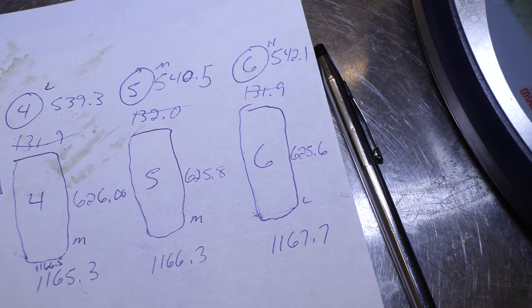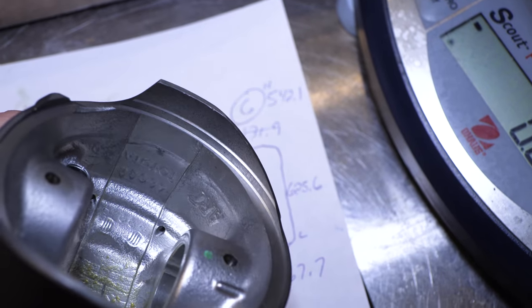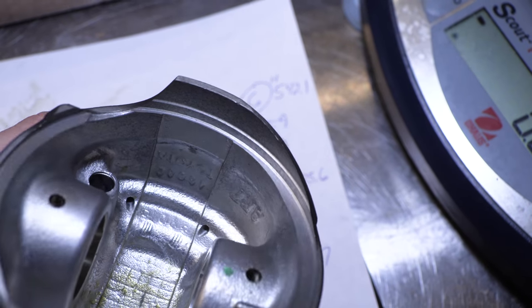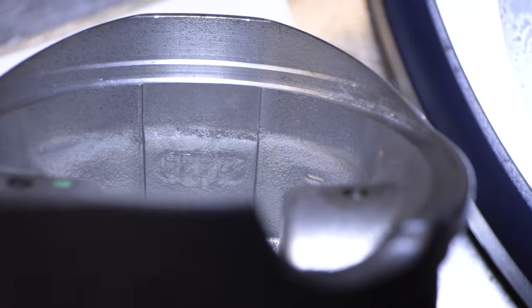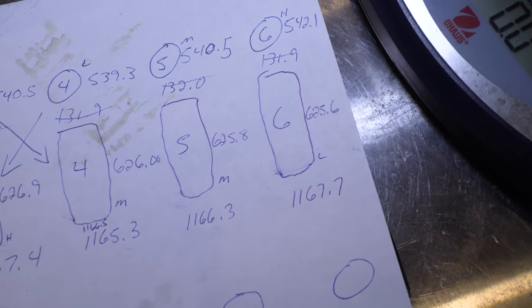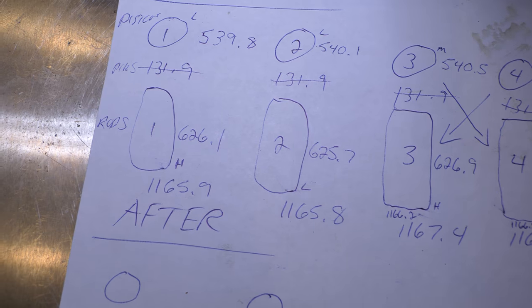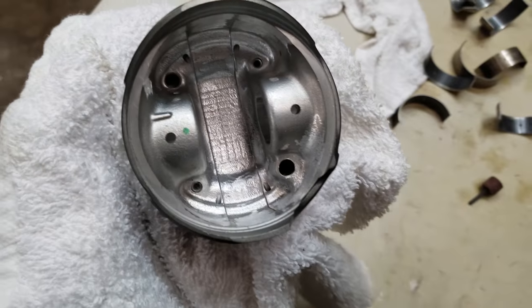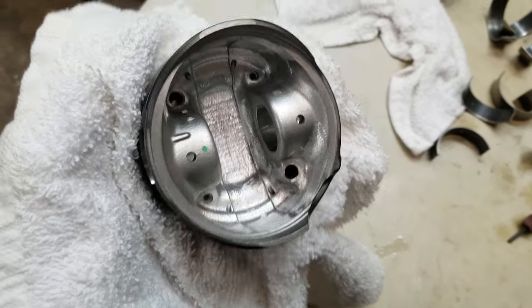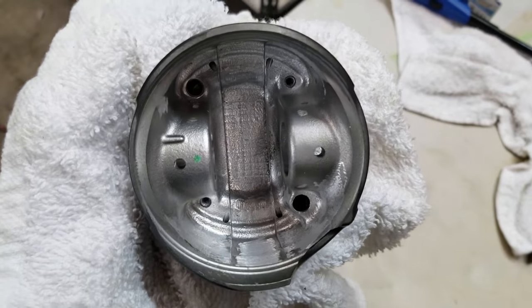This last one I'm unfortunately going to have to remove just a little bit from underneath the skirt of the piston. I usually go to the casting marks, which don't really have any structural purpose — they're just for casting, like right there where it says Toyota. I believe this is where the factory takes out some weight; I can see a little mark there. I just have to take out maybe a gram or a gram and a quarter. I don't do this very often and I'm paranoid about weakening the piston, so I use a Dremel tool with a little sanding drum to take a very thin layer off.